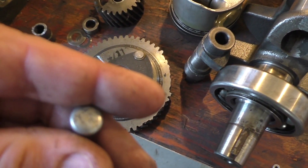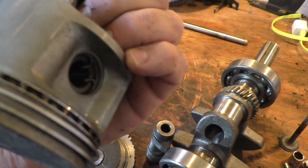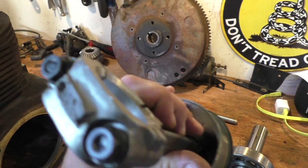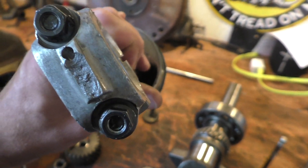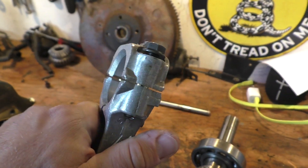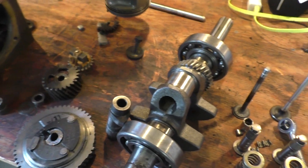This automatic compression release is just wrecked - damn near killed them. The cap is going to go back in. Here's the piston - the piston is okay. However, you can see stuff was really flying around in that engine. There's a good look at that oil hole for the crank bearing, and the oil slinger - this thing is just completely wrecked. A lot of stuff was flying around in there, and you can make out some of those dings underneath.